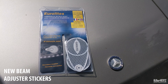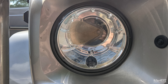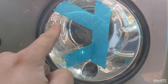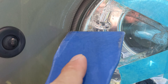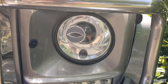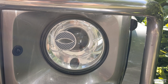The final tweak in this video was giving the headlights a fresh pair of headlight adjustment stickers. As this car is left-hand drive and I'm in the UK which is a right-hand drive country, without these stickers you can dazzle oncoming traffic at night as the beams would be pointing completely the wrong direction. The old yellowing, sun-damaged stickers had to be carefully removed — they were sun-baked on, which took a considerable amount of time. Ideally I would have swapped the headlights for right-hand drive units, but that would be over £2,000, so I stuck with the new stickers which smart up the front end nicely.